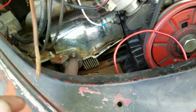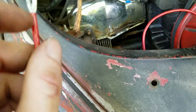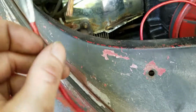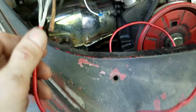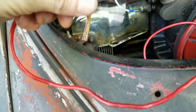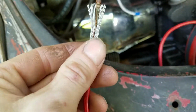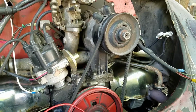But yeah, you mingle them together real good. I mean, you can do 2, 3, 4 inches. I would recommend, if you're doing anything close to like a 4-gauge or 2-gauge, you want to mingle a lot of it, but it gets really difficult when it's really big wire. I mean, even this, you could say mingle 5 inches of this, and then tape the ever living crap out of that huge chunk of it. You don't ever want to cross them over and twist them together, because you're not getting a whole lot of surface contact. This way, you get much more surface contact. Just a little FYI info. Let me get this thing wired back up.